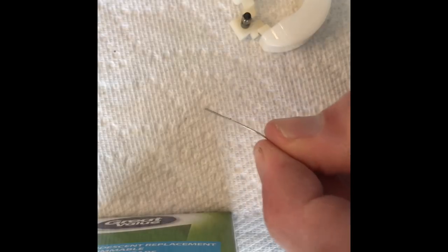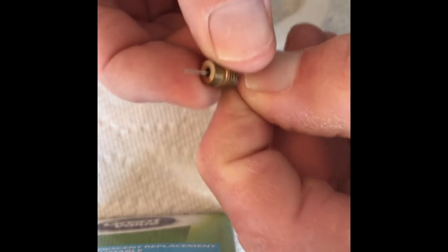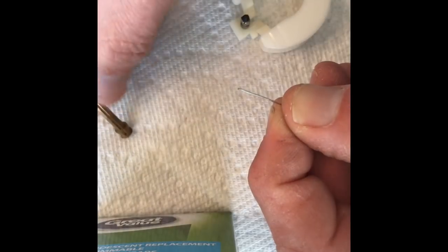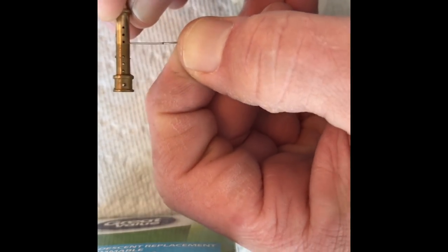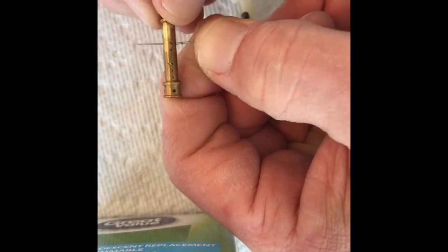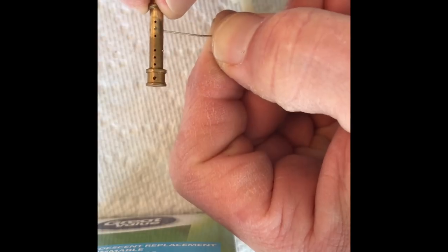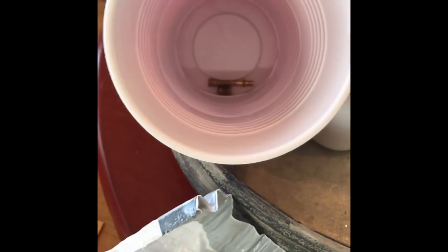I found a really small wire. That bottom piece — you can put the wire all the way through there; make sure that's clean. You can also spray some cleaner fluid in there. For this piece with all the holes in it, the pin goes through each one of those holes — make sure they're all clean, go through each one both ways. I'm going to soak this piece in cleaner. You can see all kinds of crud coming out — it's hard to see on camera, but when you push it through you can see it pushing out all kinds of stuff.